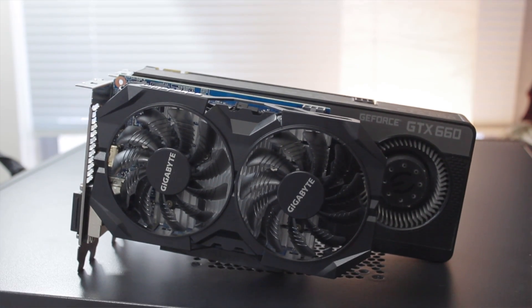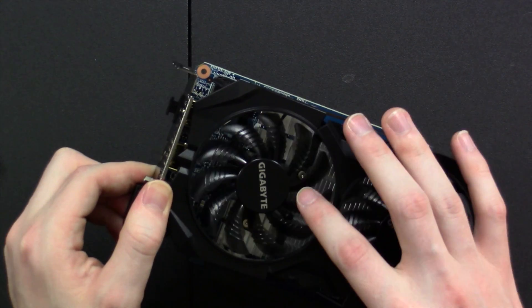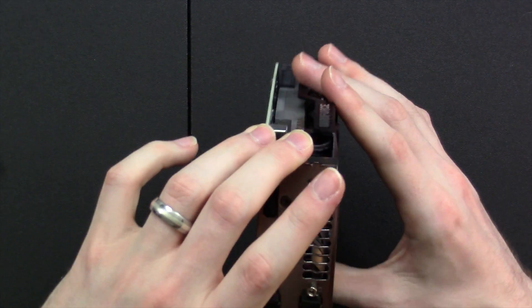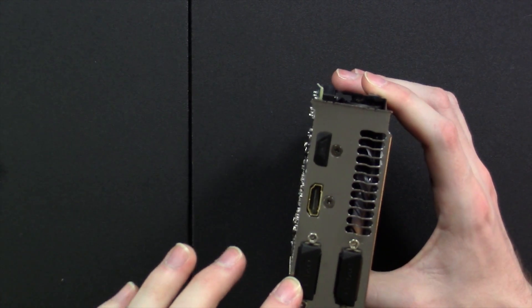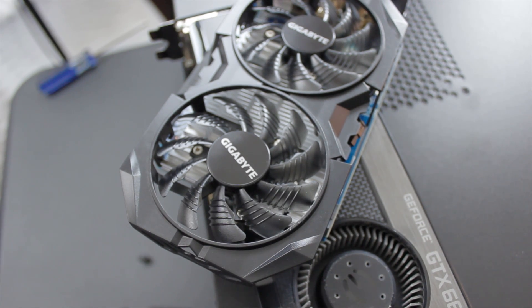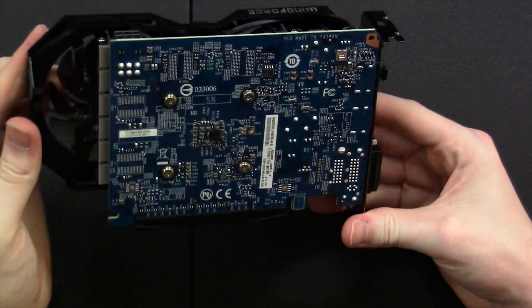This is a lot of a shorter card than my 660. My 660 was from XFX — it was a blower style card. When I bought it I had no clue what I was doing, so I bought a blower style when I didn't really need to. It outputs all that heat straight out the back and doesn't cool very well. This one should cool really nicely — the fins look really slick and the heatsink looks pretty nice. It's got dual DVI ports, DVI-D and DVI-I, and two HDMI ports. We won't even be using most of them since it's going in a server I run headless via Windows Remote Desktop Protocol, and there's a 6-pin power connector here. I'll get this installed and show you some rendering benchmarks compared to the 660.